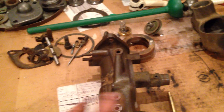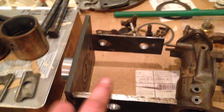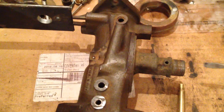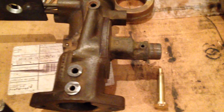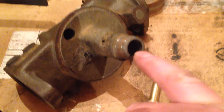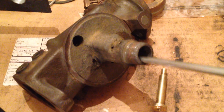What I've done is put the carburetor body into that holder I have, then put that in my four-jaw chuck on the lathe and trued it all up so this is running central. Initially I took a drill bit, put it up inside and recut the area where the shoulder of the nozzle sits, then took a slightly larger drill bit and recut this area — drilling down inside to get a perfect finish in there and relining it all back up.